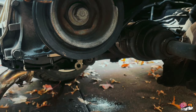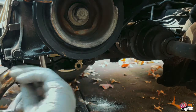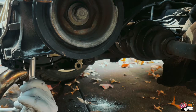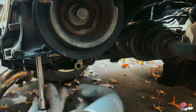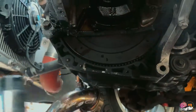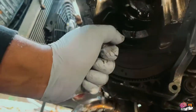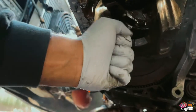I'm like, why the 14? 14 kind of fit. So I went down to the 12, that didn't fit, so 13, okay. Ugh, shit, my arm keeps getting caught. Okay. Yep, breaking free. Alright, so for those wondering how to actually take the pistons out, really just push them out. That's it. Take all the 13s out. I prefer a rubber mallet to tap them out of the bottom bearings that they're bolted into, and they'll jump right out. Then you can use a couple extensions to pull it in the cylinder wall, and then just push up and it'll come right out.